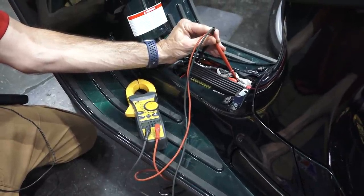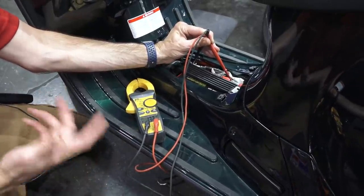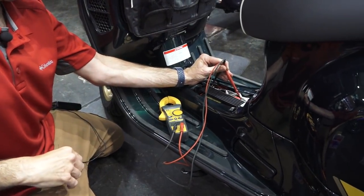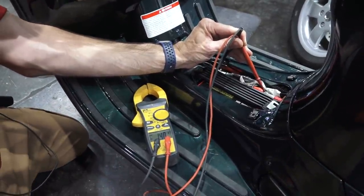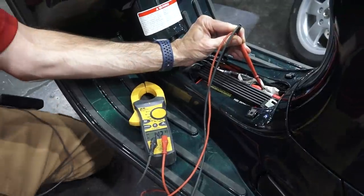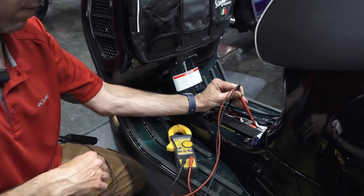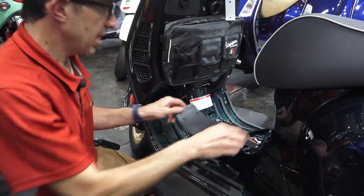The goal is to make sure it never goes over 15 volts. A standard charging system should peak out anywhere from 14.4 to 14.7 volts. Turn the scooter on — you can see the voltage drops, cranks nice and fast — and then you should see the voltage come right up as the charging system charges the scooter. A brand new scooter is never really going to exceed 14.4 volts, so it's charging just fine and not doing anything abnormal like hitting 15 volts. We know we're all good, and we can put the battery cover back on.